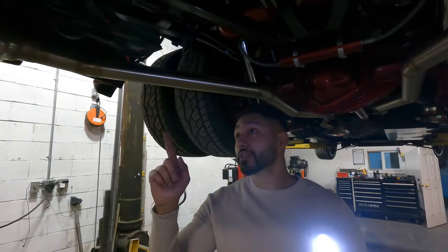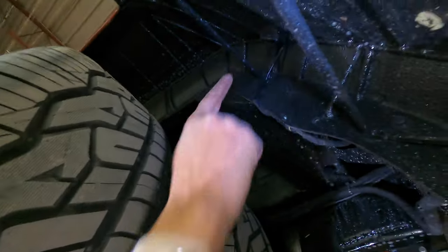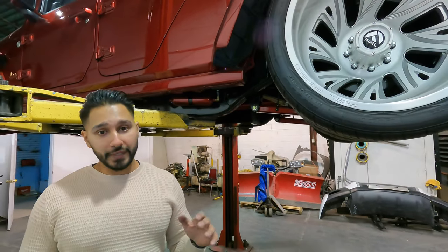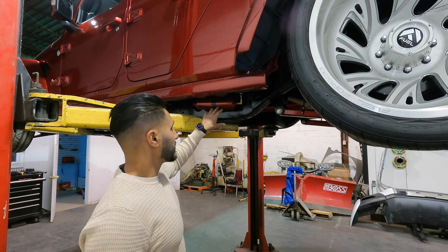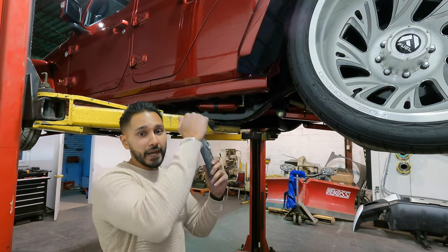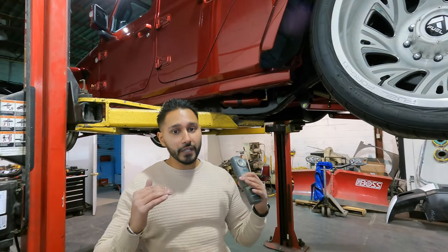For the lighting, we went with Twisted Pro LEDs — super bright lights, really nice. We went with 14 lights, even got them in the flares. We put them on quick disconnects so if the flares have to come off, everything is wired nice. Driving the Jeep in Vegas for the first time felt amazing — it drove better than stock. A huge thanks goes to these reservoir tanks for the air ride: when I hit a bump, the extra air rushes into the tank and rushes back, acting like a shock absorber, making the rear ride so nice. The front already rides nice because it's independent front suspension compared to a solid axle moving up and down at the same time.